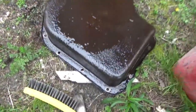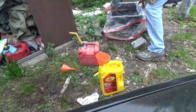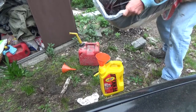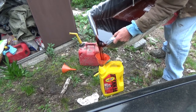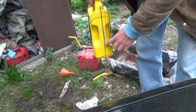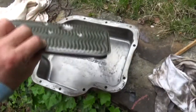Make sure you get all the crud out of there and get a steel brush. Before I go to the auto store, I'm going to fill this jug up and look at it — that's going to tell me about how much new transmission fluid I'm going to need. Already, because it's filled up, I'm going to need more than six quarts. Now I'm going to take these down to the auto store and match them up.